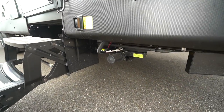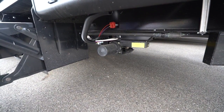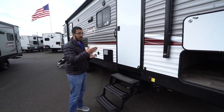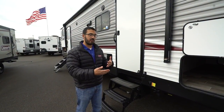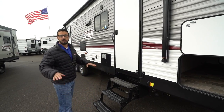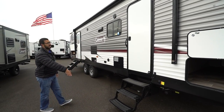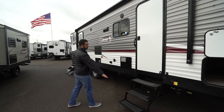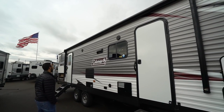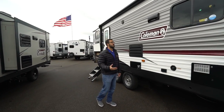Something that did change for 2019 — they have added power stabilizer jacks. You have to love that. You have the power tongue jack and power stabilizer jacks, which definitely makes things nice and easy. Bear in mind, you want to make sure the travel trailer is level — those are not levelers, they're just stabilizers. So after you level the coach out, you just touch a button: this one here controls the front two, there's another one in the back to control the rear two. That will stabilize the coach so it's not rocking as you're walking around inside. This is the secondary entrance into the bedroom — three-fold solid steps with a grab handle. Up top you'll see the power awning — touch a button to roll it out, same thing to bring it back in, and it has an LED light strip for light at night.